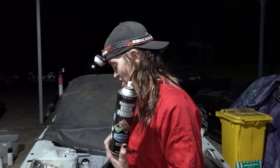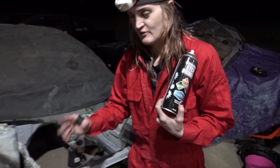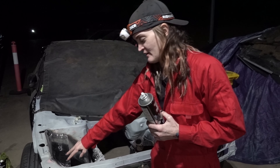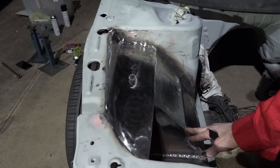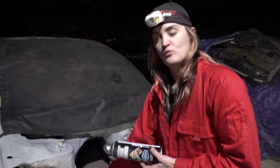I don't know when I'm going to be back here, so I like to seal up my metal when I'm not around — just in case of surface rust, because I'm grinding a lot tonight. I'm going to hit it with some etch primer. I'd usually use the primer filler, which is thicker and makes a smoother surface, but I'm using etch primer because it's easier to sand off in the future. It bonds paint to metal, and I'll come back later with primer filler to build it up and get these super straight.